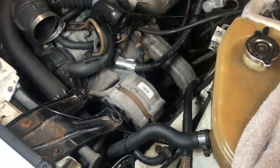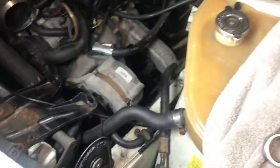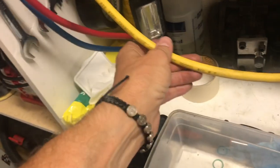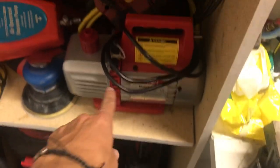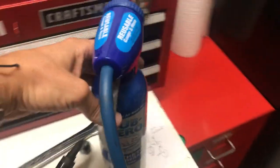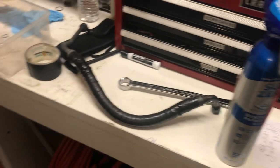All this other stuff on the engine, you guys probably have wrenches, tools, screwdrivers, and a can of WD-40 and you're pretty much ready to go. Air conditioning is much, much different, and I'll tell you why. These gauges — everybody knows about those when you're first starting out. There's usually a blue, red, and then this is your supply for your vac pump and a blower. Air conditioning is expensive. These gauges are around $500, you buy a condenser for $300, and one of these lines from Porsche is $195. You can have these made, which is kind of the conclusion I'm coming to.